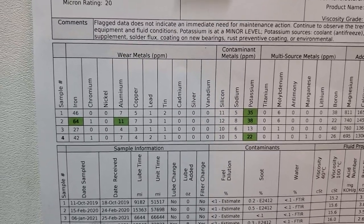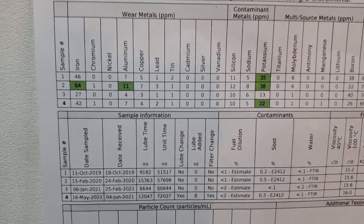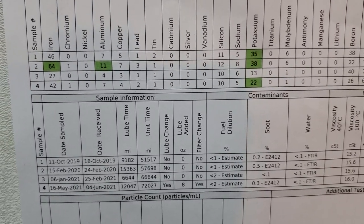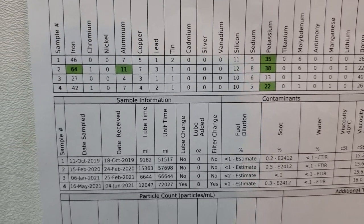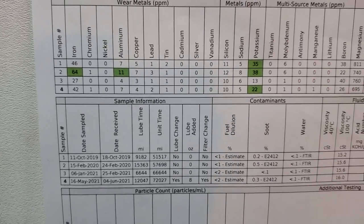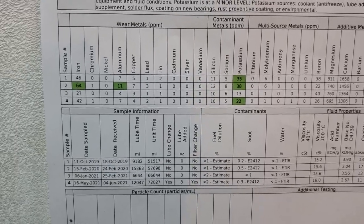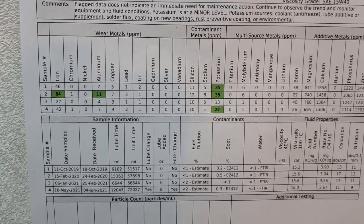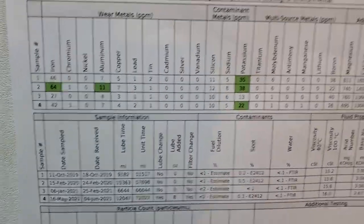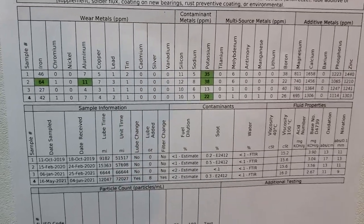Even 40 ppm with only 2,000 miles — that's crazy. Look at these numbers and compare them. With 15,000 miles, it's not an overkill if you do the analysis and follow the report. The oil was still good at 15,000 and you could push it further. One of my subscribers shared this report with me and I'm sharing it with you guys.